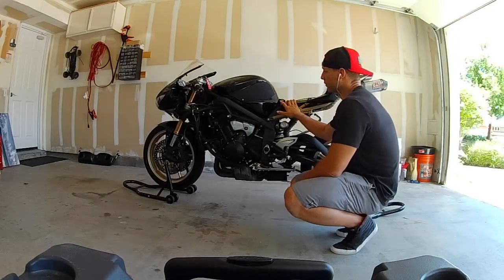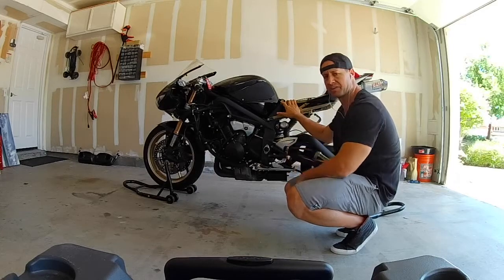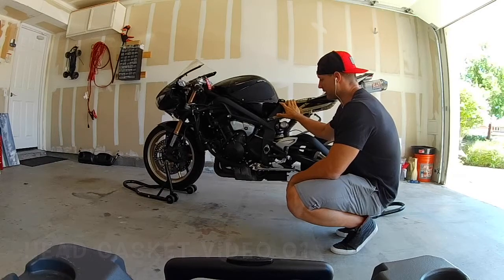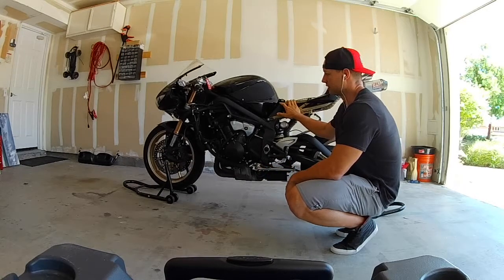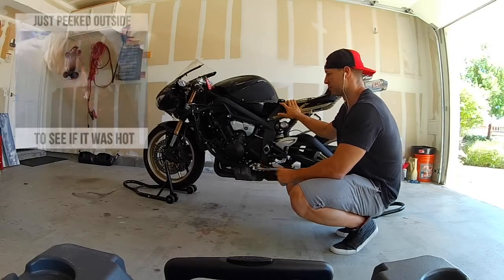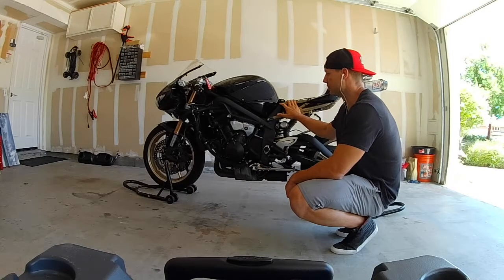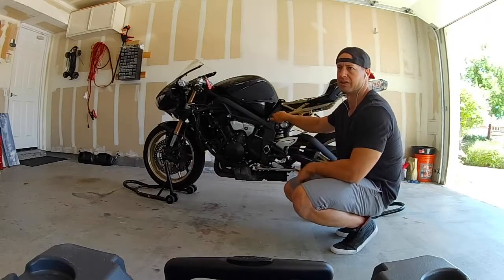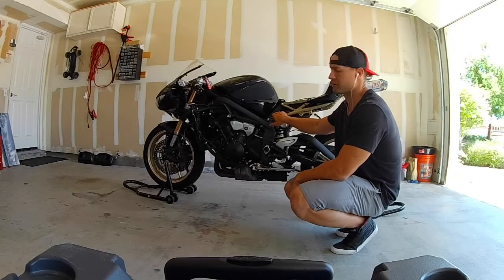I'm going to start a larger project with the bike. I'm pretty sure it has a slightly blown head gasket. Finished up a track day — ran great, it was hot, 90 degrees over Fontana, no problems there. Definitely was super hot and the fan came on multiple times during the sessions. But I got back from the track day, let the bike sit for a couple days, started it up, and there was a bunch of white smoke coming from the tailpipe.